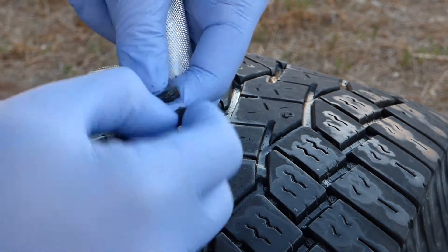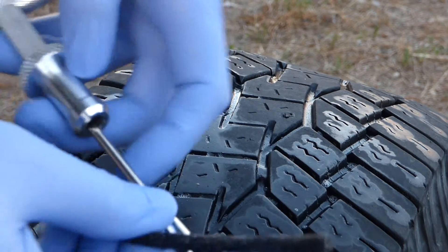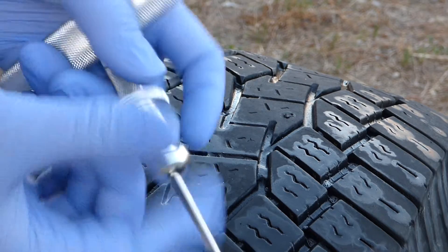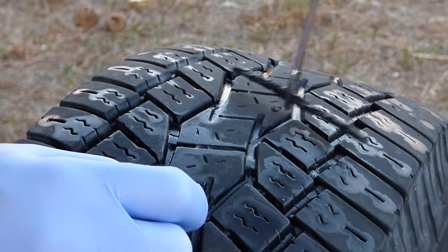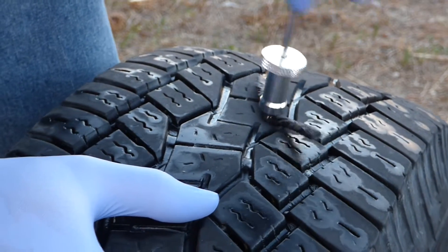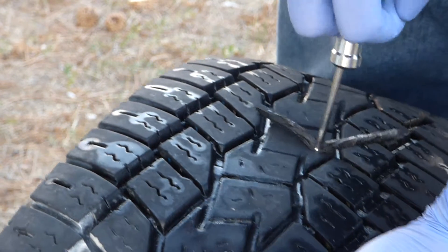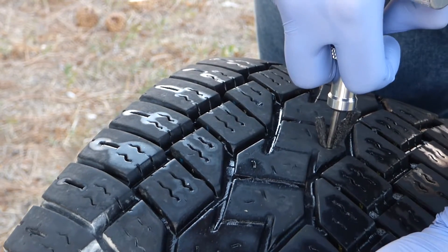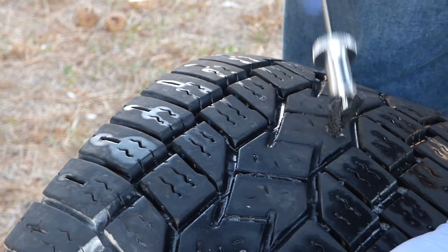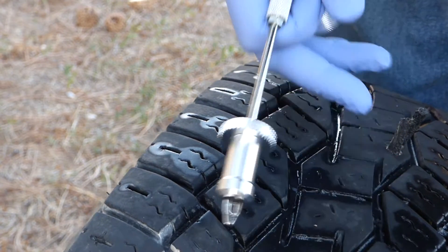It feels like it's got some tar and stuff on here. You put this plug through the end of the needle here. I've got the plug in the needle. This guide is apparently used to make sure you don't go in too deeply. So I'm going to push this in. This part is going to be pretty difficult — the plug is quite a bit larger than the hole. Just yank that back up. The plug is in there. I'm going to trim this off with a knife and we'll see how this goes. I've only used this type of product one time before, so I'm hoping this works out well.